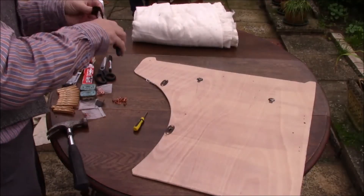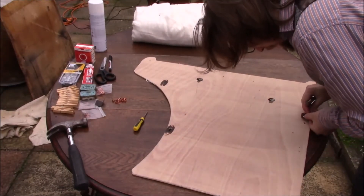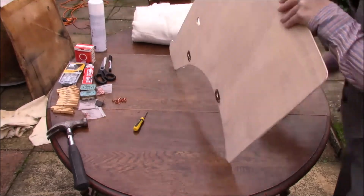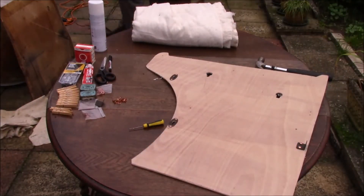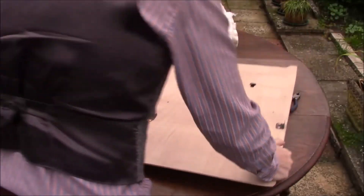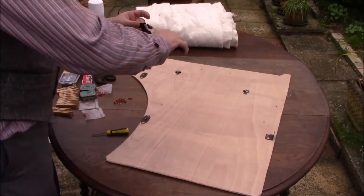Don't actually do it like that — I'm just barely clicking how you do it with a hammer. You can see Pat in the background there, busy doing more sanding. Normally I wouldn't go to the trouble of setting this up outdoors — it was a faff. This time of year, you haven't got much hours to work in with the daylight, and it gets pretty cold, and then of course you've got to tidy up. But for the purposes of this video it worked well enough. When you do the brackets, because you can't lay it down flat for the rivets, I find using the brick worked quite well as like a spacer. So with all of your brackets going on, this is the side that faces the door, so this isn't the side the fabric goes on.